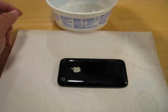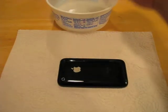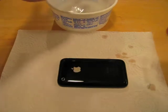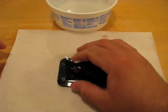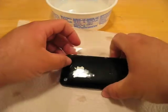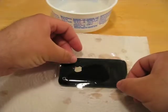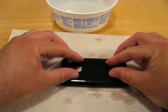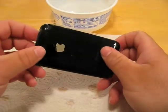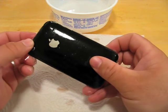I'm going to shake off the excess — they said you don't need it dripping wet, you just need it a little moist, and I found that to be true with the Zag on the MacBook too. You can actually move it around; it's very slippery once it's on. You can see that's laid right over there. This is going to be a little bit more tricky as it's the iPhone. I don't obviously like water on it, but I actually lay it upside down so we don't get water on it — that's why I have this to catch most of it. Now it will evaporate and get more sticky, so what we want to do is line it up the best we can, then smooth it out and smooth all the water out.